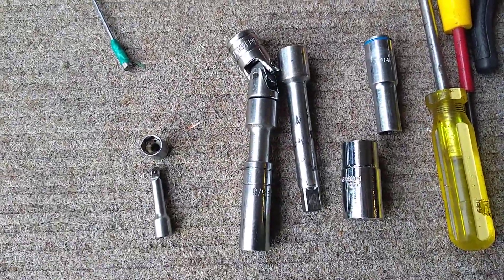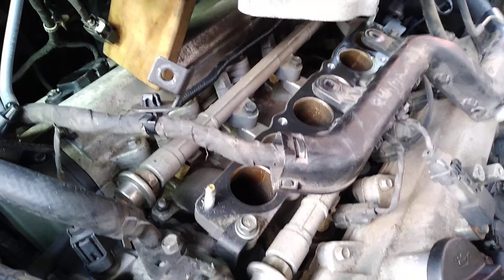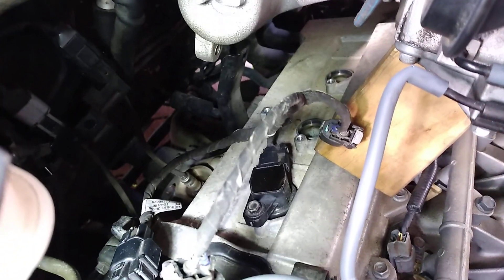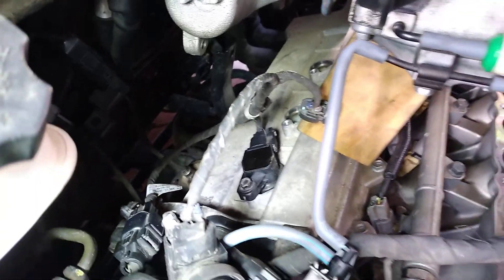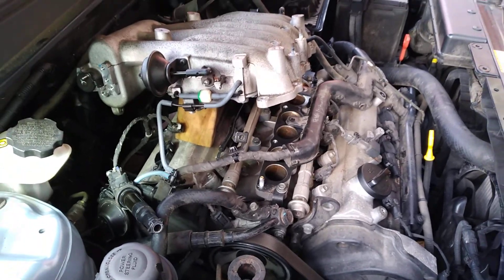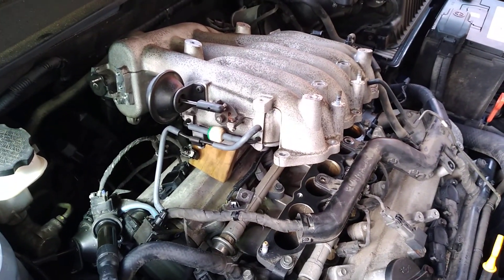One of them was a little bit of trouble getting out. The spark plugs are quite deep so be careful there — I'm using my extensions and a knuckle, and a little magnet to lift it out. I'd certainly recommend this job — it can be done by any reasonably confident do-it-yourselfer. I'm only half an hour into the job and I'll have it all boxed up in another hour quite easily. Tighten everything down using this torque wrench.